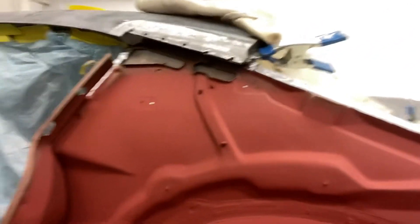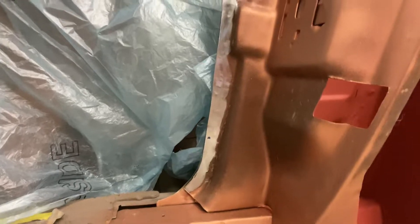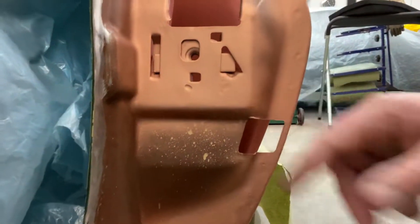On the car I did the same thing around the window — prepped that all to bare steel inside the jam. For all the spots I'm not gluing on the vehicle that I'm going to weld, I put this weld-through primer so there's no bare steel showing; I'm just going to weld right through that primer.